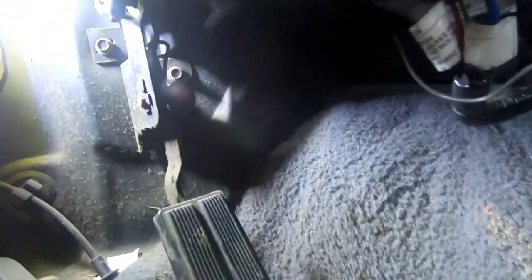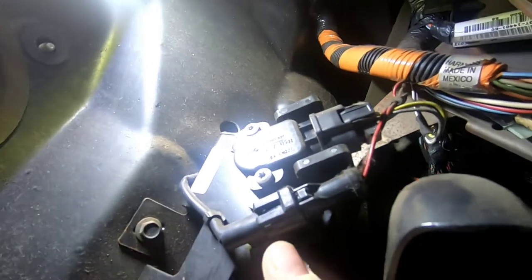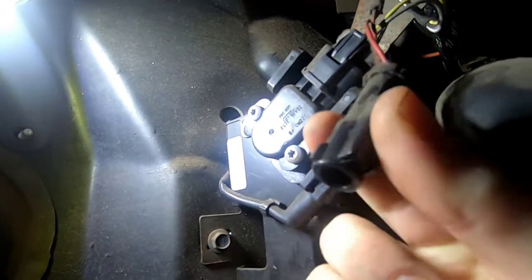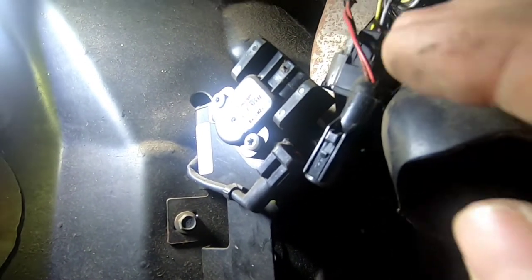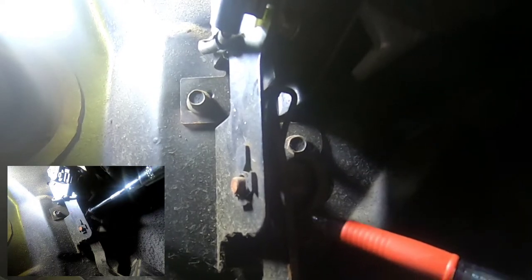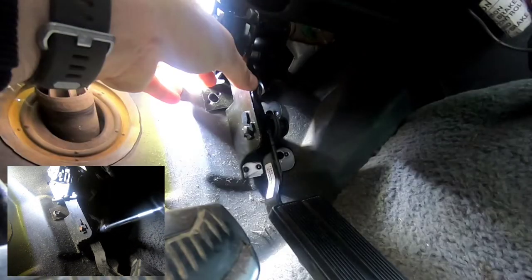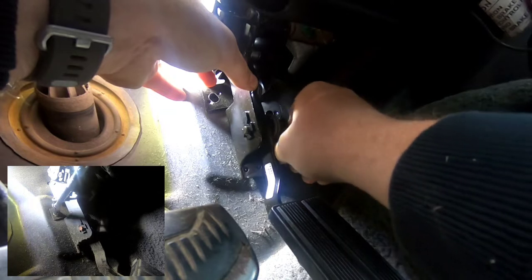The first thing you're going to want to do is come down here — let me get a good camera angle — and remove these plugs. They're pretty simple; they have a little release mechanism and you reach up, press the little tang in, and it comes right out. Same with the fat one — it's got a little tang on the back side. Press in, it comes out too. There are only three 10-millimeter bolts that hold this in: one here, one down here that you really can't see because of the lighting, and one over here. Once you remove those three bolts, the entire assembly should come right off.